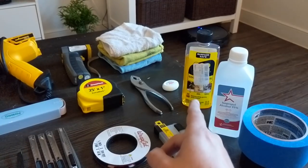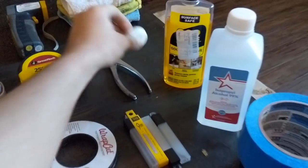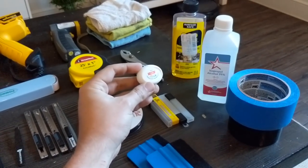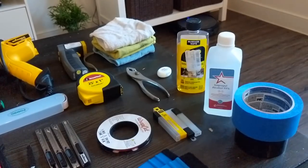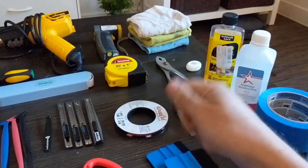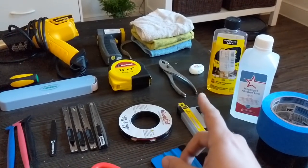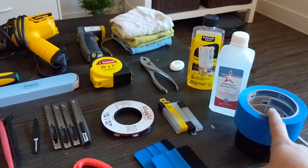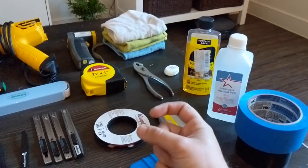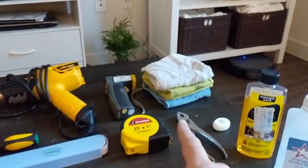I didn't cover debadging in the other videos, but I did debadge the 90D. It was a combination of floss — though I'd actually recommend finding some fishing line instead, something a little more durable. Heat up the emblems with your heat gun a little bit, take a good piece of fishing line, and it zips right behind the letters in the emblem and they pop right off. I'll describe a good method I learned from CK Wraps on how to save your emblems so you can reapply them. Once you've taken the emblems off, it leaves a little residue behind — take the Goo Gone with a little heat and your nails, and the old adhesive comes right off.